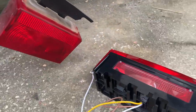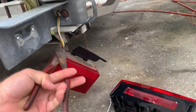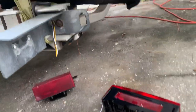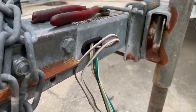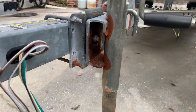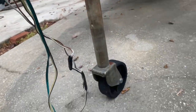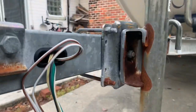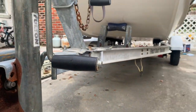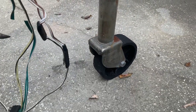Since I've got an entire new wire that's going to run through, I'm going to take these with some side cutters, cut them off, and end up taping it to my new wires, pulling it all the way under the side of the rail and through. Coming up to the tongue of the trailer, I've got my old plug — all of this is going to get pulled through from the front to the back. The reason we pull it front to back is because the new plug on the new wiring won't fit through all the wiring track from the back. So I'll take my side cutters and cut all of this off.